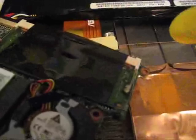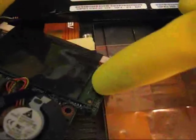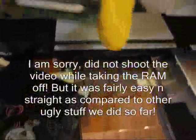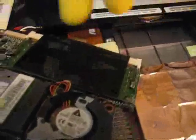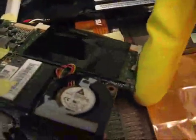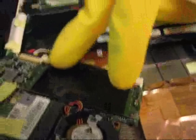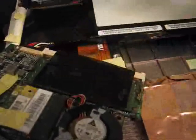Once this thing came out, there are two clips here — you just need to push them out and the RAM will come out immediately. It's pretty easy. Once the RAM comes out, you take it off just like this. This is the RAM I just took out. You insert your new RAM there, push it in, remove the black sticker from this RAM and put it there. I don't really know why they use this black sticker, but I guess it is to protect the RAM from dust, because there is a small opening here. So we plug the RAM now, which looks pretty much nice. Now there is one more Herculean task to connect everything back.